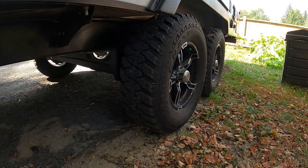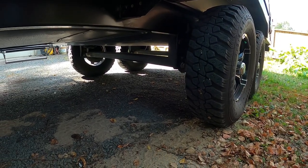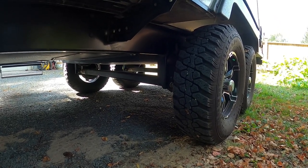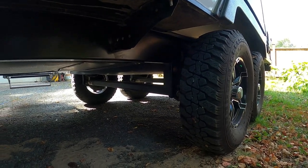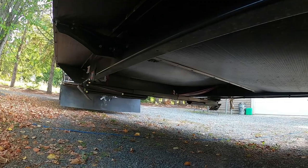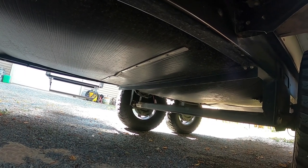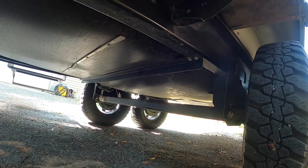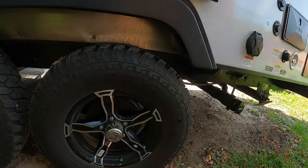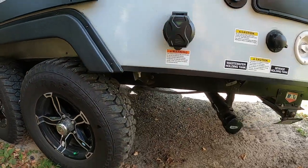Being a mechanic, I like the larger tires on it and instead of leaf springs it has torsion axles, which move more independently and ride a lot better — your trailer isn't being jarred around and stuff isn't falling out of the cupboards. It has what they call an enclosed bottom — a thick plastic covering underneath — and the heater in wintertime can blow air down there to keep things from freezing up. It's got six-ply tires, 235/75R15s, nicer for gravel and bumpy roads.